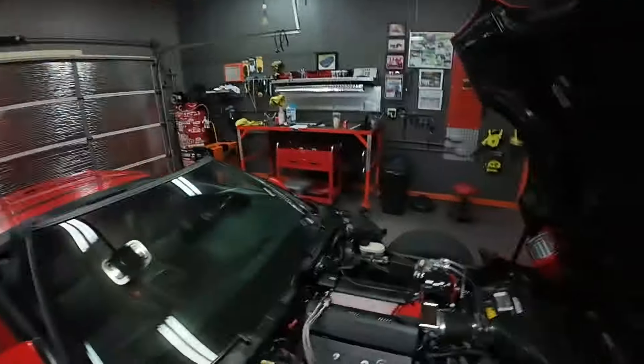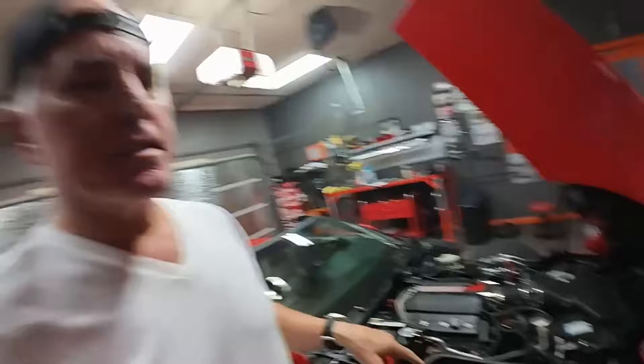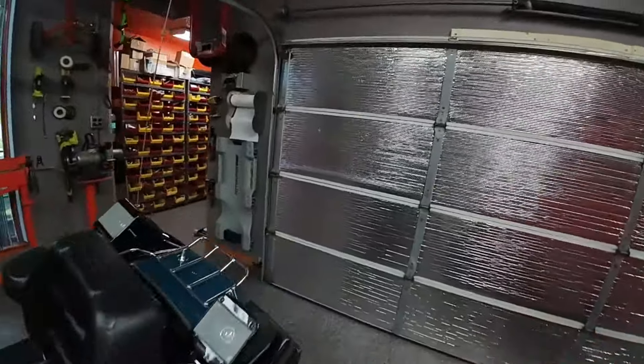Took me a couple of days to get my head around it, but I got it done. There's a great engine shop here locally — Wayne Calvert Engines. Told them what I wanted: tap it up to half inch, the next size up from 7/16ths. But now I needed a very specific puller, and since I'd changed the threads to half inch, a puller for that configuration didn't exist anymore. So I had to make one — hardened threaded half-inch rod, grade-eight nuts, and some heavy-duty washers.